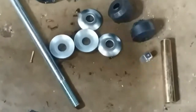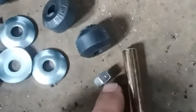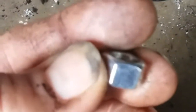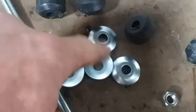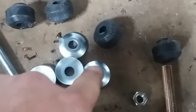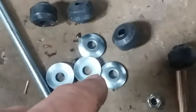This is basically your setup for one sway bar end link: you've got the bolt, you've got the shaft, you've got your cup washers, four bushings, and a nut. Now if you look at that little square on there, that means it's a lock nut — a mechanical locking nut. It means the threads are just slightly different. It's actually the threads are offset just a tiny bit so that way it goes on hard but it'll lock in place because of that. What I do is I always throw a little bit of grease on the inside of these cups because that's what the rubber rides against. That way it keeps it from squeaking, keeps it from rusting. I do the whole shaft too because this slides over top of that, goes between two of these washers, keeps everything separate. Keeps it from squeaking and will keep it from rusting — serves dual purpose.